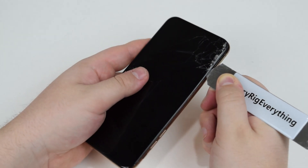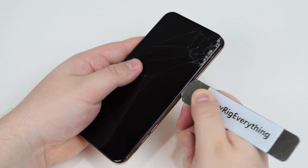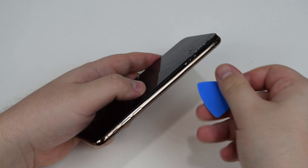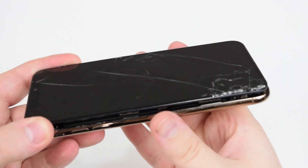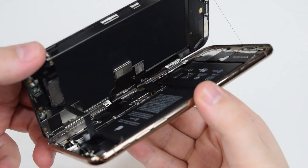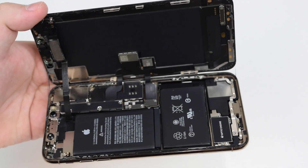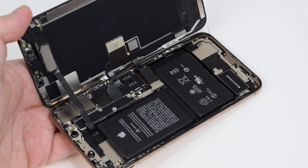Using my favorite creator's pry tool, we're going to start digging into this iPhone XS Max. I switched to a pick here because I really didn't want to damage the sides of the device — as you can see, when I was turning it, it could have been scratching the metal, so I switched to plastic just to make sure. As this iPhone opens up like a little booklet from the side, we want to be very careful and not hit any of the flex cables on the right side. As I opened it up, I saw some adhesive on there, which is a good sign because that most likely means it wasn't opened and repaired before.